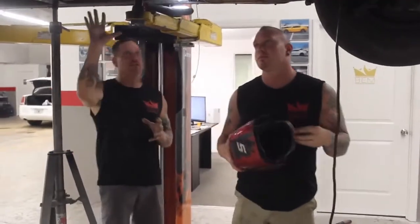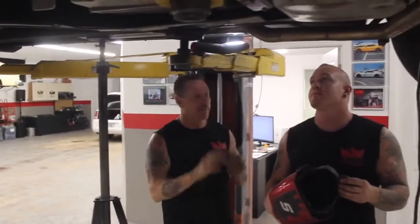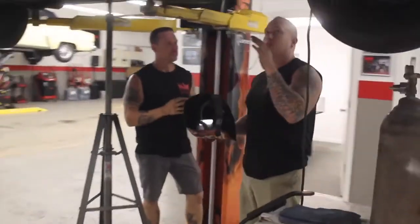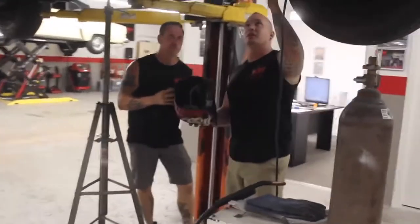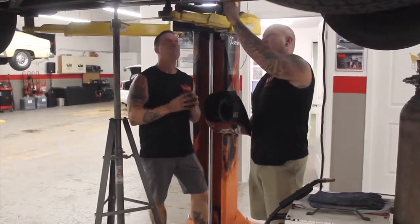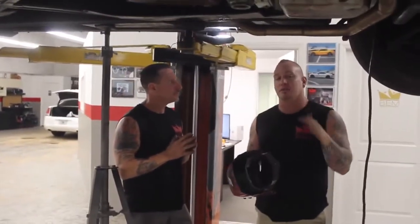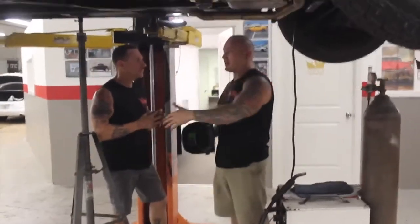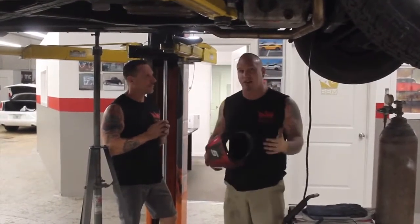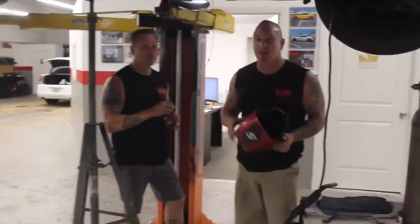Here we are underneath the '65 Rolls-Royce. We've hand-fabricated the pipe through the X-channel we just learned about. I've already got the front pipe — everything from the front Y-pipe assembly — which is coming off the 304 stainless steel from each side of the engine. That Y-pipe assembly now runs all the way through about three feet or so. I'm going to pop it in right now through the X-frame, through the channels, and there's perfect clearance everywhere. I'm going to get the system marked and clamped and tack-welded into place, check all my final clearances through that frame, make sure we have no vibrations, then pull it through the X-frame and get the single final welding done.